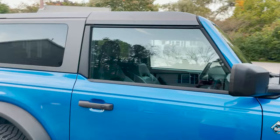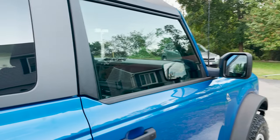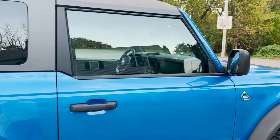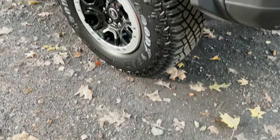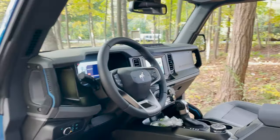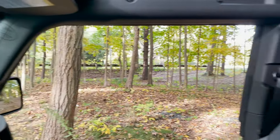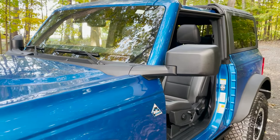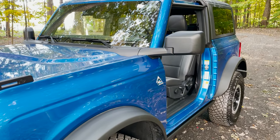Final thing I just noticed: you need to actually reset your windows. So when you put your doors on, after you put your doors on, you need to roll the windows all the way down, roll the windows all the way up, hold them until the vehicle will lower the windows automatically. Otherwise you can't close your doors. If you're waiting for your Bronco or you have any questions on my build or the Bronco overall, definitely leave a comment below. I'm super thrilled — with the feedback on the last video and over a hundred new subscribers on one video, that's a record for my channel. So I'm super excited about that. If you have any questions, definitely leave a comment below, subscribe if Broncos interest you, and I'll catch you guys in the next video.